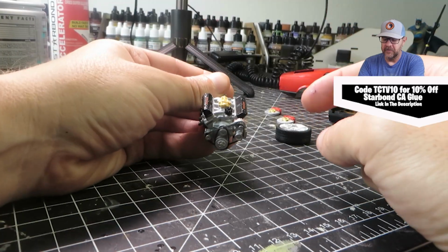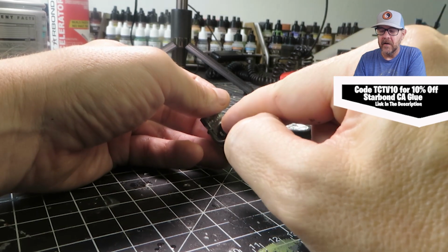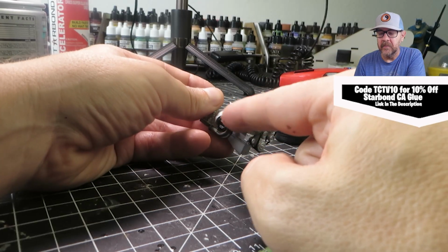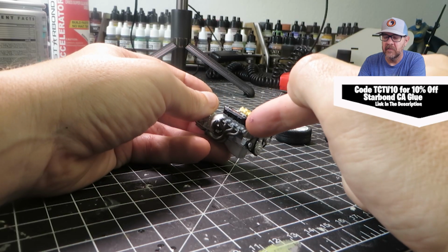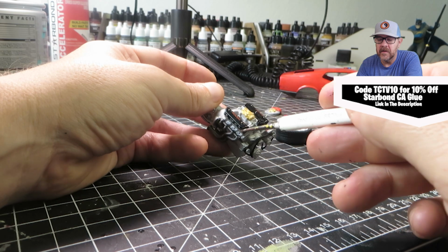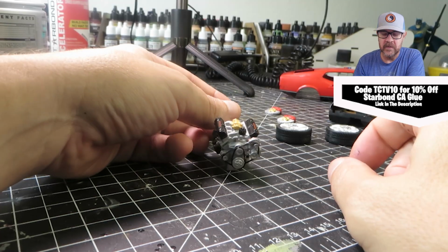You can see I've started the first step for wiring up the spark plugs. I put the distributor in, and I actually drilled the spark plug holes. But here's the problem, I forgot to order some 90-degree boot plugs for the wire. Basically, I've looked online, and most of these Roush motors, they just pull the wires right up against the valve covers and then real tight to the engine block, and then they go back like this. Right through here, just real tight up against all this, and then real tight around the valve covers here. And so you need a 90-degree spark plug boot to make that happen.